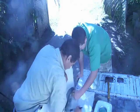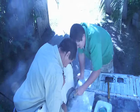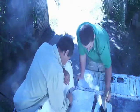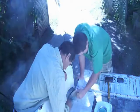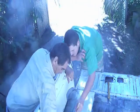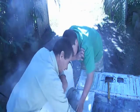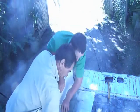We've got to work fairly fast with the glass, although we're using very cold mixes. A cold mix basically means it takes longer for it to go off, so we have more time to work and get it clean and neat onto the job. There you go. Ryan's doing a good job of keeping us in wet resin. You'll notice him wearing some humongous chemical goggles.